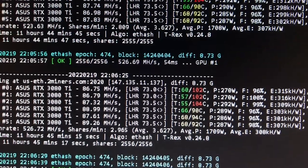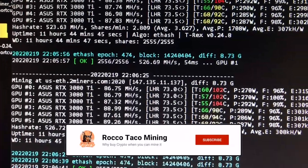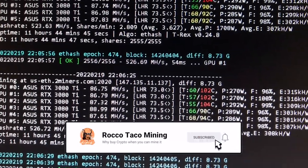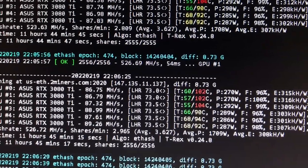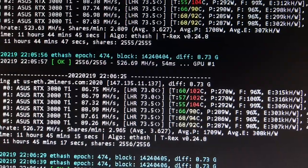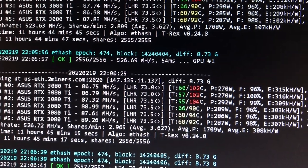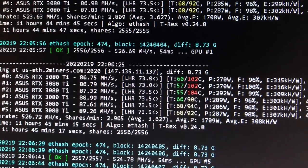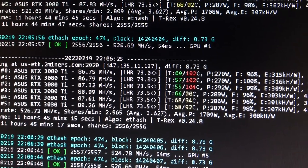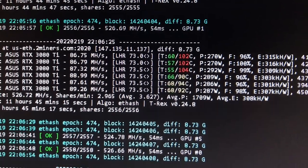Have you seen this? Is this the indication that you should take that top GPU off, strip it down, clean it with isopropyl alcohol, get all that stuff off, and measure the existing thermal pads with the calipers so you know the correct size to replace them with? I ordered multiple sizes from 0.5mm up to 3mm, just so I have a nice little toolkit available to replace these pads.